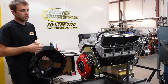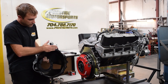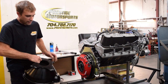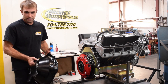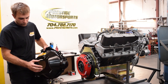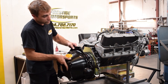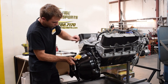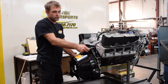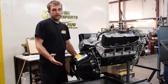Now if you're going to be in a racing application with high RPM shifts, then it's probably a good idea to clean the mating surface that meets up with the block plate as well as the surface that meets up with the transmission — that would give a nice machined surface. These are actually surface-ground bell housings, so the only misalignment or tolerance difference is the amount of powder coat on them. We do have other videos on how to properly check and set up parallel alignment as well as concentric alignment. Now we'll put all the bolts in, torque up the bell housing, and move on to setting up the bearing free play and how to check those measurements.